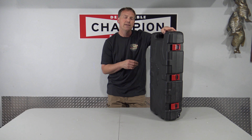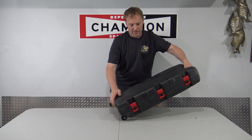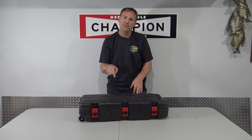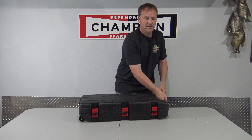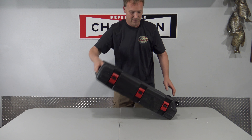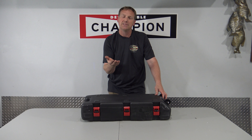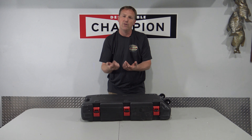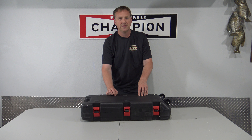Now for storage — I highly recommend you store these flat. I wouldn't store it on this side. If you remember how the inside looks, it has that sight gauge on the bottom. Store it so the sight gauge on that oil is going to be on the top side, so there's no oil pressing against that nut and that o-ring. That's going to prevent this from ever leaking. Hope you guys found this video helpful and informational — thanks for watching.